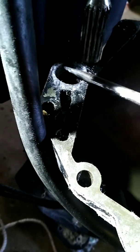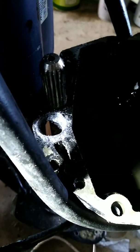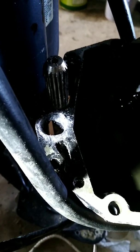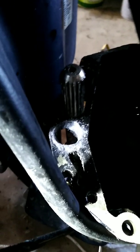So here — cleaning all that corrosion out. That's what's pushing the rubber grommet in. I've already cleaned a lot of it out so it doesn't look too bad, but I've still got more to go. Then I'll prime it with some really good primer — I'm going to use epoxy. If you've got any really high quality primer, do that, so you do it right the first time and don't have to do it again in a few years. I've painted some epoxy inside there, and then I'll clean the top to make sure it's a nice seal for when you put the gasket back on. It looks a lot better now and should hopefully last.